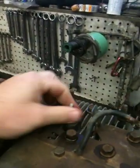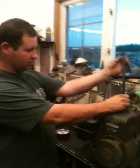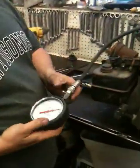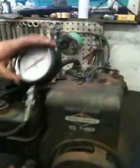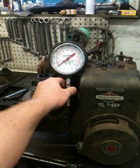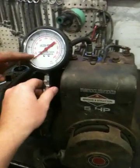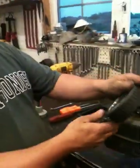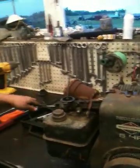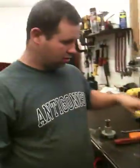We've already pre-loosened all the bolts to be time-efficient. This here is just a compression tester — you use whatever hose is necessary for the proper thread size, just a quick connection. Make sure your ignition system is off, pull it forward, and normally your gauge would go up. You should have around 100 to 120 PSI for good compression.